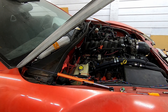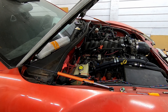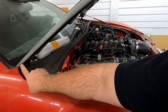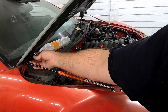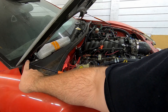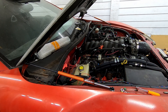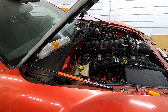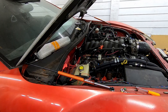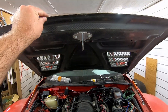It's probably meant for the lighter aluminum hood. Sadly these cars do have a lighter aluminum hood than carbon fiber, but it's holding itself up just fine. A few taps — I wonder if I switched it from the back to the front but put the offset to the back instead of the front so it would have the right length. I'm going to try that real quick. So we have flipped the brackets back to the front, but instead of the nub being at the front it's at the back — top bolt out to the back, hump goes down this way. This is a lot more sturdy.